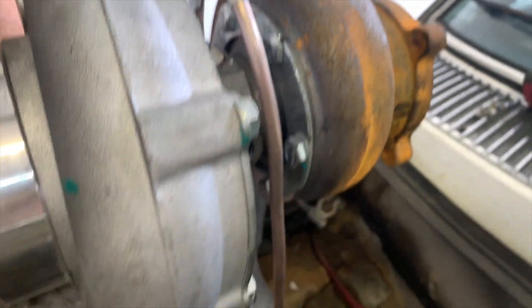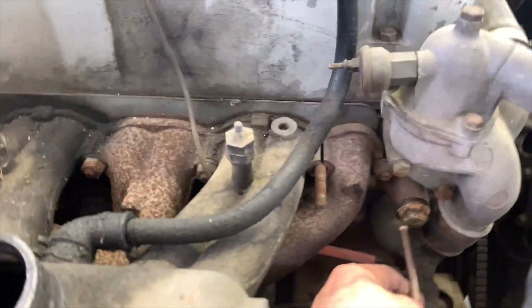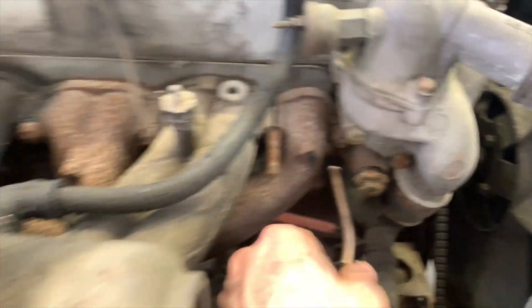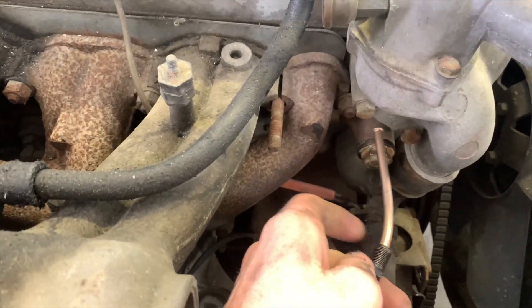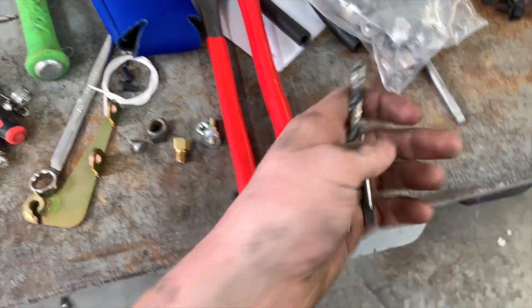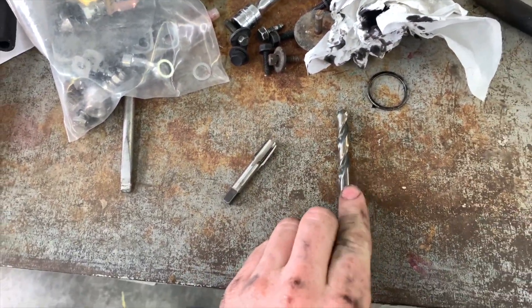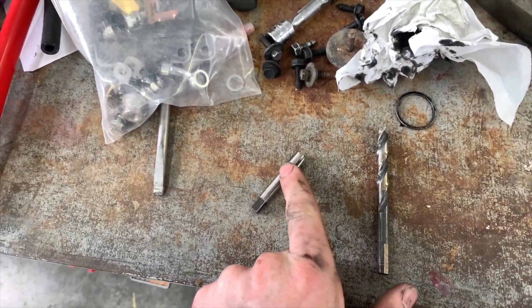Let me show you what I got. Comes out of here, I'll go straight down, come across under the intake, and then I'll be able to tap it in right there. I'll just take this threaded part and screw it straight over there. It actually looks pretty good and super simple. Here's my drill bit, my tap. You use a 21/64 drill bit for a 1/8th national pipe thread tap. A little bit of knowledge for y'all right there.